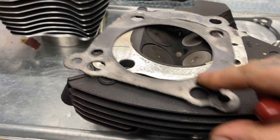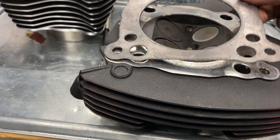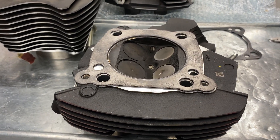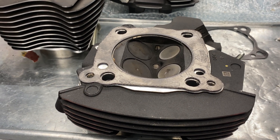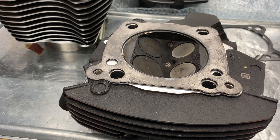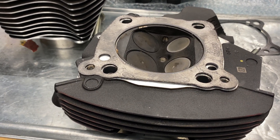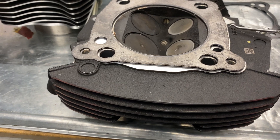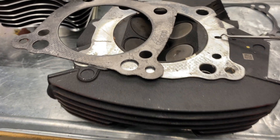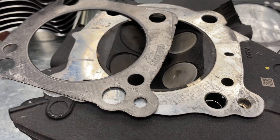What happens with these motors is whether from factory we've had an incorrect torque sequence — depending on the person, the bike, the day — I call them Friday motors for a reason. If the torque sequence is incorrect by any means of torque allowance, over time we can potentially see that gasket lift marginally, which will see oil disperse from there and create its way into the cylinder, burning with combustion.